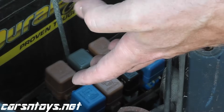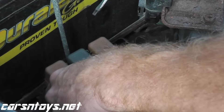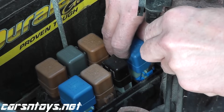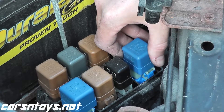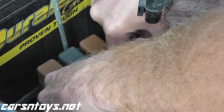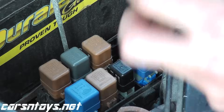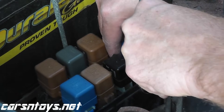Let's say you've pinpointed that you think it may be a relay problem — this is something you can quickly do. Right here you have a harness connector, so I'm just going to push it out a little bit and pull up on the relay. Just want to be gentle, especially with something like this that's 20 years old. And there you go — there's relay number one.